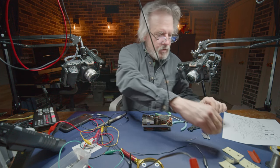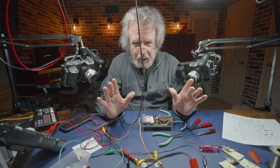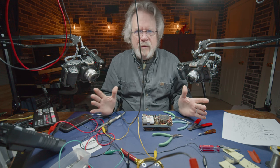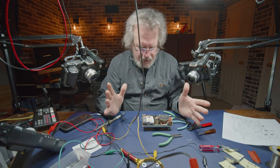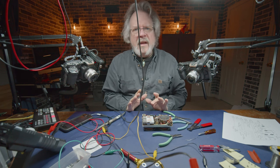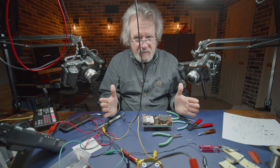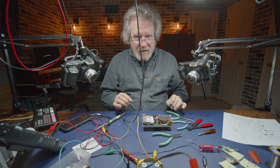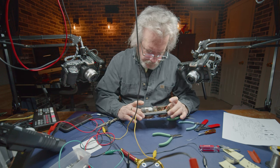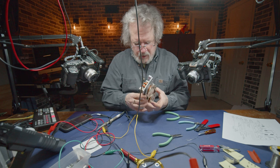I'm going to very gently drop these screws back in, snug the screw up then back it off half a turn. When putting things back together, I recommend getting all the screws in place but nothing tight - then on the last screw start tightening them up. That allows all the screw holes to line up properly, then you tighten up all the screws. Moment of truth... and nothing.